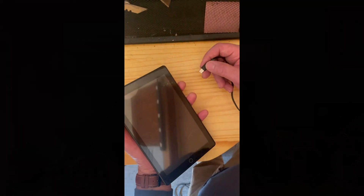If you're having trouble getting your Tone Traveler tablet to start — perhaps you've had it stored for a few weeks or months with no charge — it's gone into battery safe mode. The fix is to use a fast charger. These are available for many devices like iPhones and iPads, allow you to charge about twice as fast, and are 3-amp 5-volt chargers. You'll need one of these for the following procedure.